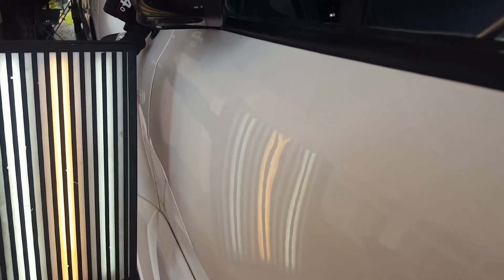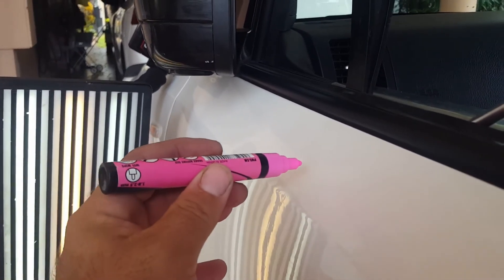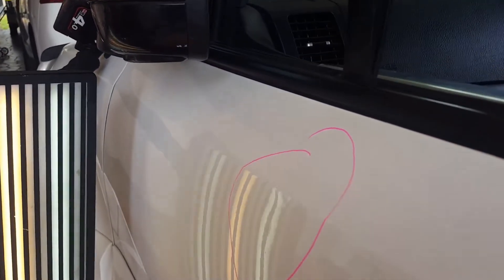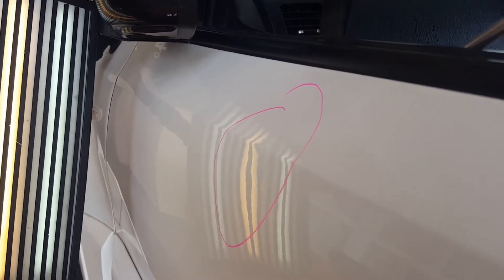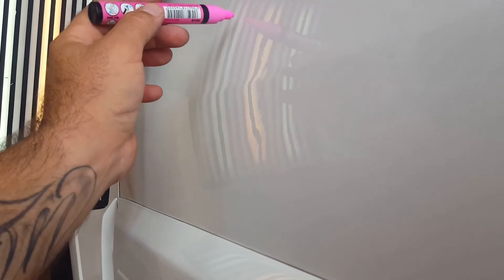I'll spin the camera around and show you. You can see where those lines are still — still a bit wide, still got damage there. You can see as the lines pass through the damage. That body line has come up but it's still got quite a deep little low spot that has to be worked up, but we're getting there. Same down here — you can see the lines. What we want in the end is these lines to be nice and straight, all the way through the damage.